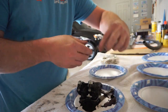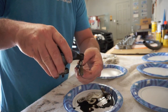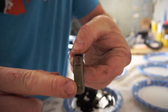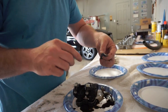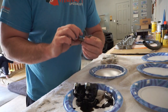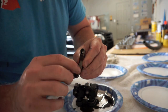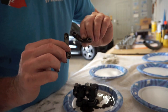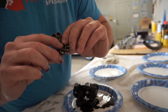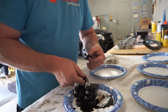These bridges — I'm not exactly sure what they're called — are what go down on your exhaust and intake valves. The rocker pushes both those valves open via the bridge. The dimple or dot usually goes towards the intake side or the driver side, so they all sit at kind of an angle. Make sure all those dimples go towards the driver side. Also, this hole right here is smaller and that hole is a little bit bigger — this is my exhaust side, which is the bigger arm, and this is the intake side.